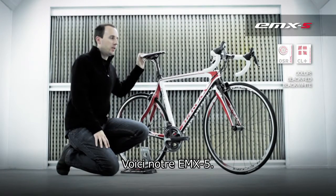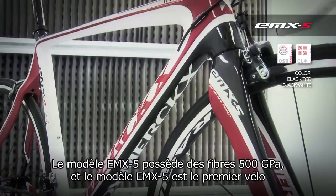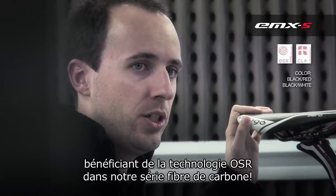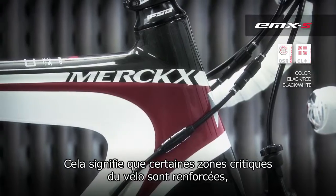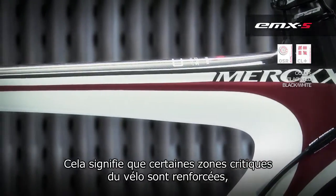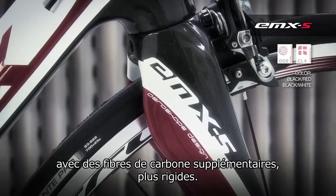This is our EMX5. EMX5 is built around a 500 gigapascal fiber, and EMX5 is the first bike that uses OSR technology in our carbon fiber range. OSR stands for optimized structural reinforcement, and what it actually means is that we're going to reinforce certain critical areas in the bike with an extra amount of carbon fibers of a higher specific stiffness.